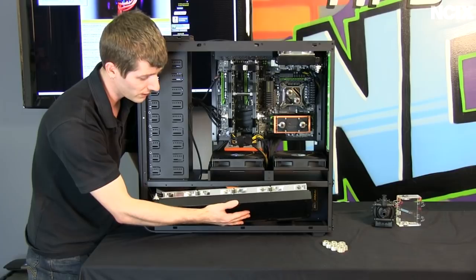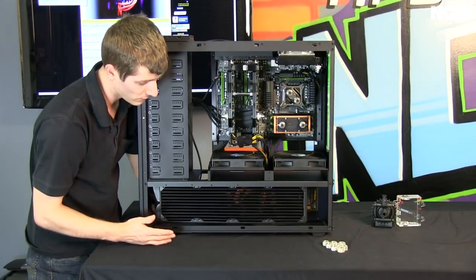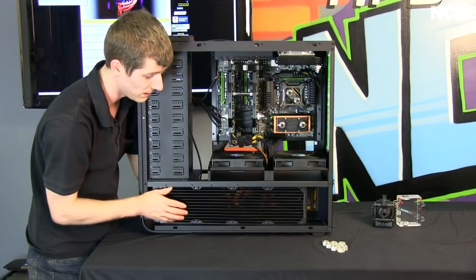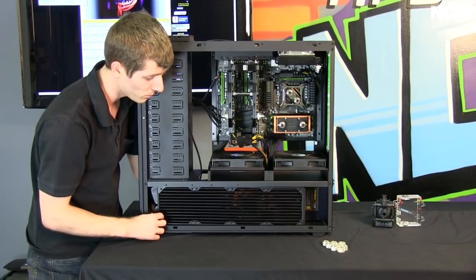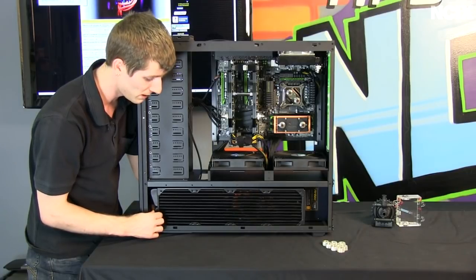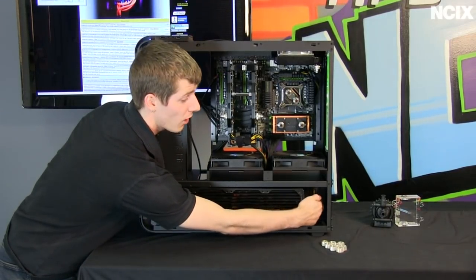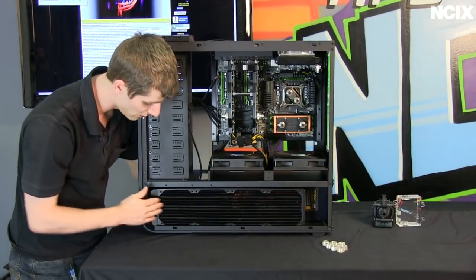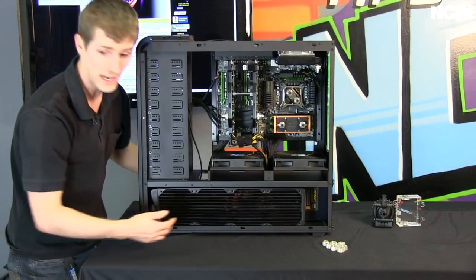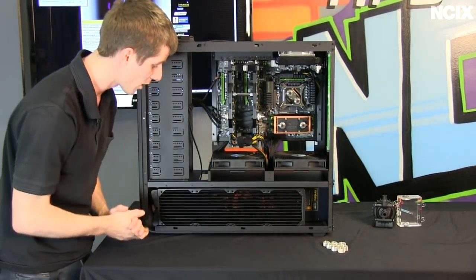Right now I've got my quadruple radiator, which I'm going to mount in the basement of my case. Two things to watch out for when positioning the radiator: first, make sure the side panel will still fit without interfering with the radiator; and second, find the balance that optimizes space on the other side for tubing management, wires, and placing the reservoir and pump. I also have a solid power supply over here, so I want the radiator as close to the front of the case as possible without interfering with the curve, so it pushes air through the bottom of the TJ11 rather than blowing directly at the PSU. The double-sided velcro holds it securely in place.